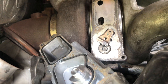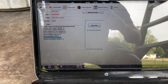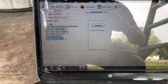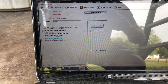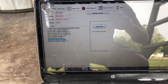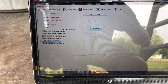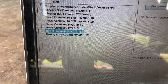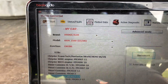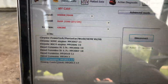I'm going to do a hard cut and pan over to the laptop. I know most of you are probably going to use Android — it seems that's more popular with Alpha OBD users than the Windows client. Mine will be set up a little differently, but the menu names and navigation should be the same. So the first thing we want to do is select the correct year — in my case it's a '13, so we're going to do 13 through 17. We want to connect to the module, and I'm on the engine module.